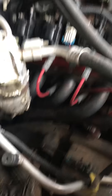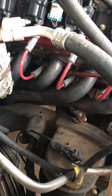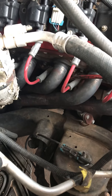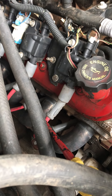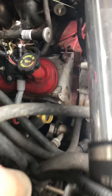There's a little quick update. I know y'all want to see this engine again — best part of the truck. Pacesetter headers. The good deal about these headers is you can get them online for about $260. Pretty cheap. I went ahead and got them used for only about $115. They sent them back because the O2 bung was facing up towards the roof, so I just had my muffler guy block it off and then tap another hole so I can put the O2 in the right place.